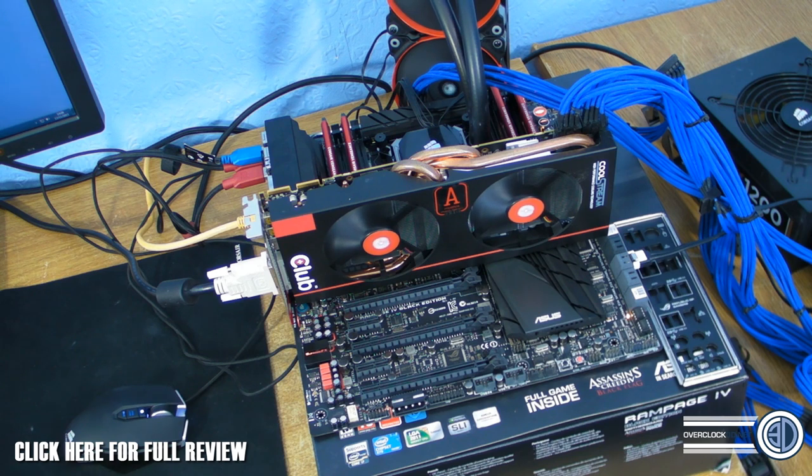We've got 32GB of Corsair Vengeance Pro, 2400MHz, those are 8GB sticks you see. Then we've got an AX1200, the individual cables, yes I know they don't match, but it was just a PSU that I had that I could use to hand really easily, because the AX1200i with the red cables is on the red Rampage. Then we've got an H100i taking care of the cooling, and the SP120 Performance Edition fans are actually on 12 volts as well, just to keep temps low when I was really pushing the overclocks.